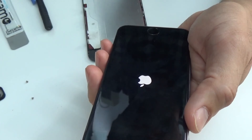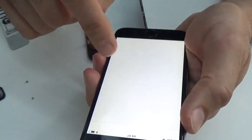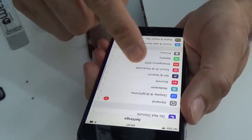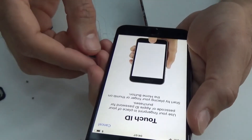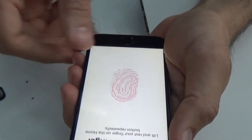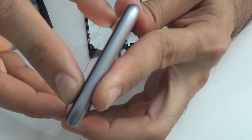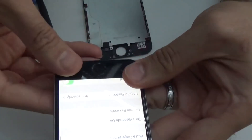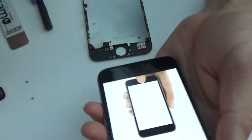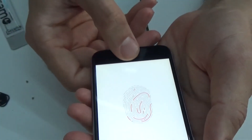It's turning on right now. Let's try that again — let's go back into the system. Touch works — that's a good sign. Passcode. Fingerprint. Here we go — the Touch ID is now working! So what we've learnt from this is that the Touch ID is unique to the hardware itself, to the board. When we swapped it back, you can see it's now working fine, which I wasn't aware of before.